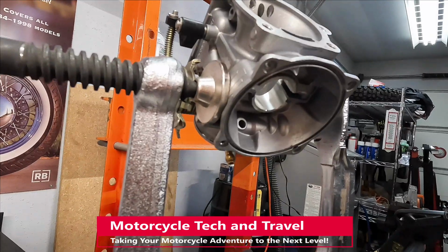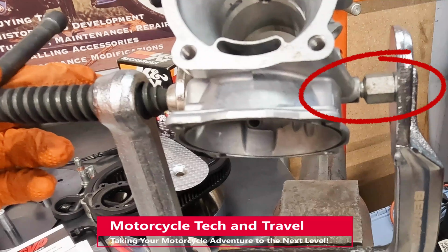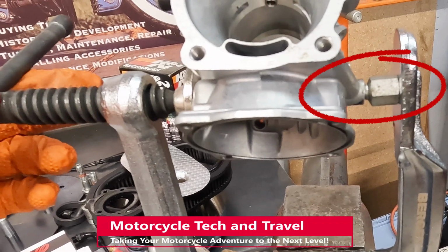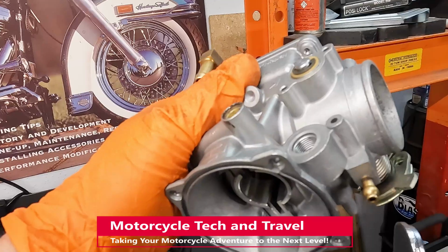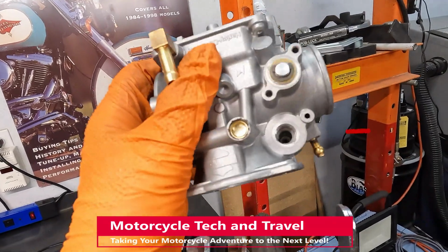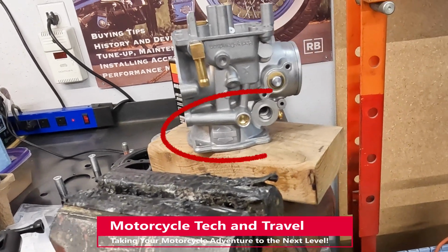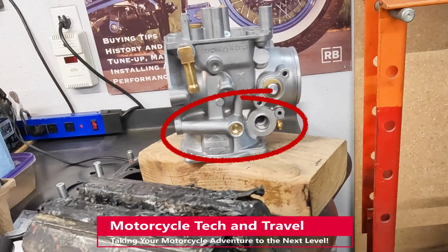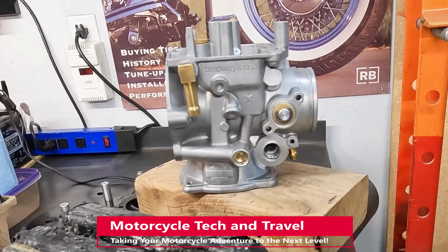The vent plugs are parallel. I'm using this square-ended steel fitting to press the plug in further. Here the plug is recessed properly and fits snugly. This is a factory plug, and this is the new plug installed. After cleanup with alcohol, there is no residue either outside or inside the plug. This is well sealed, but will not slough sealant.